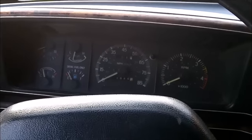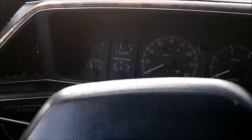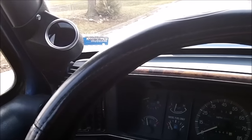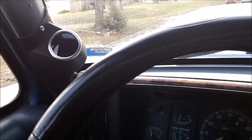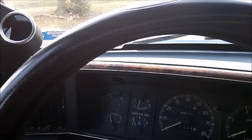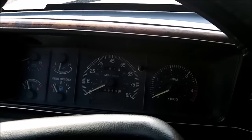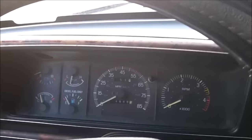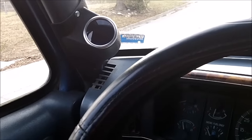After you turn your fuel up, you really want to put a good load on the motor and make sure EGTs are manageable so you don't burn it up. Keep in mind it was winter and I had no trailer — if you put a trailer on on a hot summer day, watch the gauge because you might burn your motor up if you've turned it up more than three flats. I've seen people running these naturally aspirated motors turned up seven flats, and that's just a waste with black smoke everywhere. Three flats and you can get into the throttle halfway with no smoke unless you really hammer down on it — it only smokes when you want it to, or if you lug the motor.